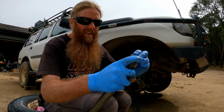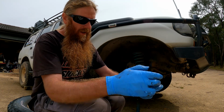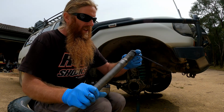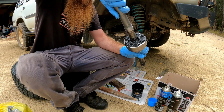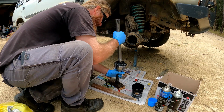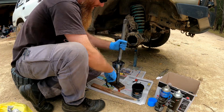So snap ring in there. And I saw a trick. If you put a cable tie around this snap ring, then that compresses it. And as you insert the axle into the CV, it just pushes the cable tie out of the way. See if I can pull that apart. Shouldn't be able to pull it apart. Nope. All right, success.